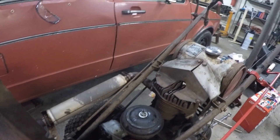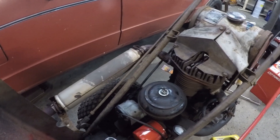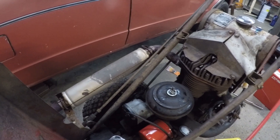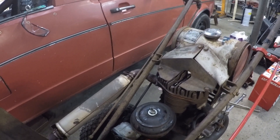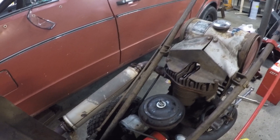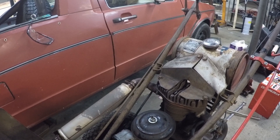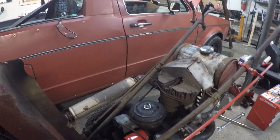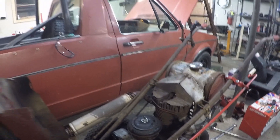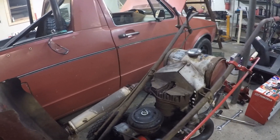This is a T-head motor, so it's technically a double underhead cam motor — it's a flathead. It's got this big external oil bath air filter, this big external oil filter, and this big external magneto. We don't need any of that. We can take all that stuff off and actually greatly simplify things by having a newer horizontal shaft motor on it. The newer motor would have more things built in — this thing doesn't even have a governor or a recoil starter. You just have to wrap a cord around it and pull it, and it takes about one minute between each pull.